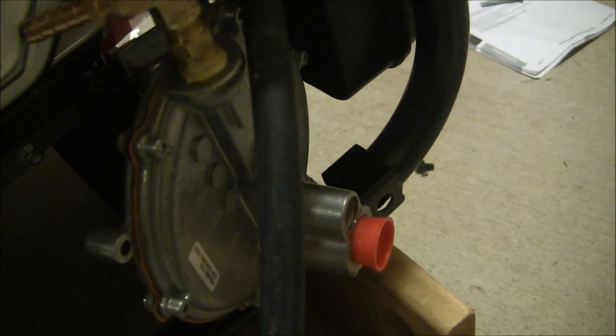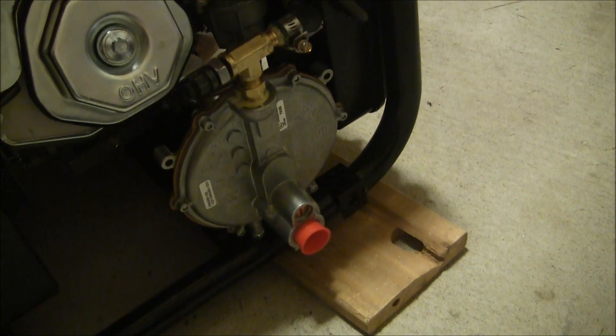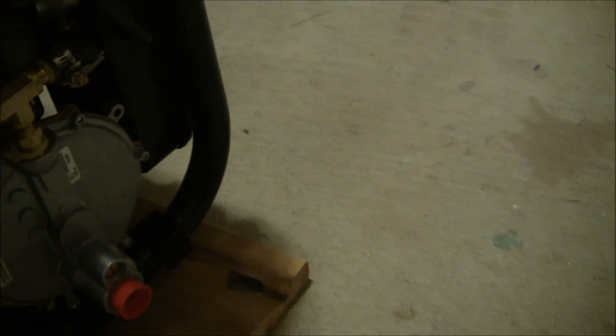I ran into another issue where this was too tight — I couldn't get that fitting in because it kept butting up against the motor. So I had to take one of my bolts out and try to screw it in from a different angle. I got it on — there's still a little give here but the sealant should tighten that up. I'm going to cut this fairly short — about here — so I'll still have probably a good foot left, getting it nice and close to the converter and the carburetor. The regulator and converter are now installed with all the new hose for the air.